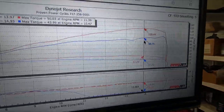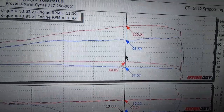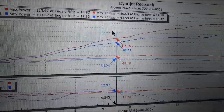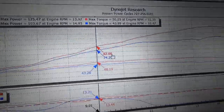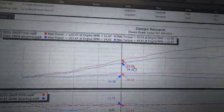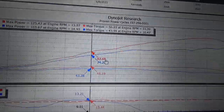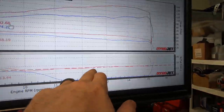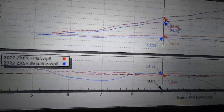This is going to feel like a freaking rocket ship compared to what he's used to — he's not going to know what to do with himself with this power band. Even right here: 98 wheel versus 125, that's 27 wheel horsepower gains. That's massive. Look at the torque — we're dealing with 10 foot pounds of torque gains. That's huge on a 636cc motor. This is absolutely outrageous. Even in the mid-range around 9,000 RPM we're picking up 8 wheel horsepower — that's around 12% rate of change. Very big gains. Air fuel ratios: we're seeing a nice clean line now dancing around that 13.2 mark, with some little peaks and valleys but within an acceptable range.